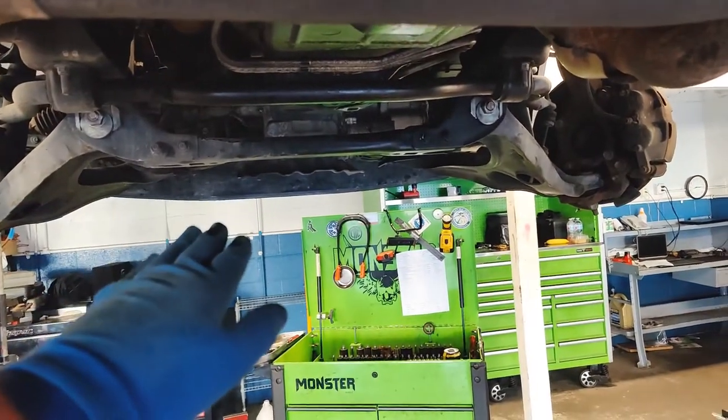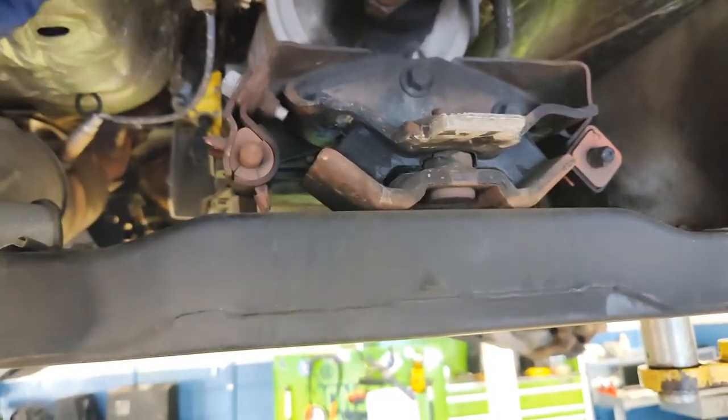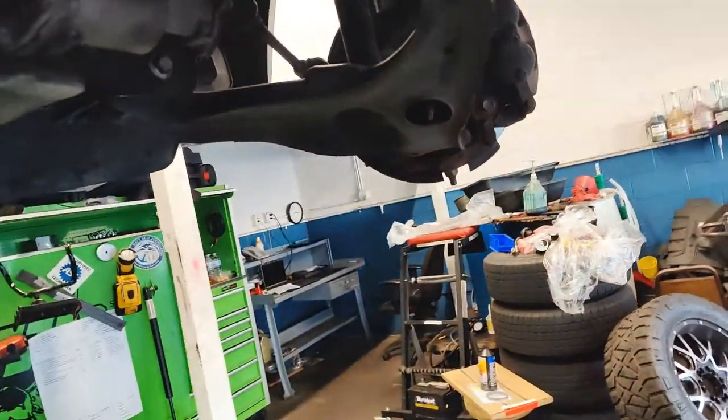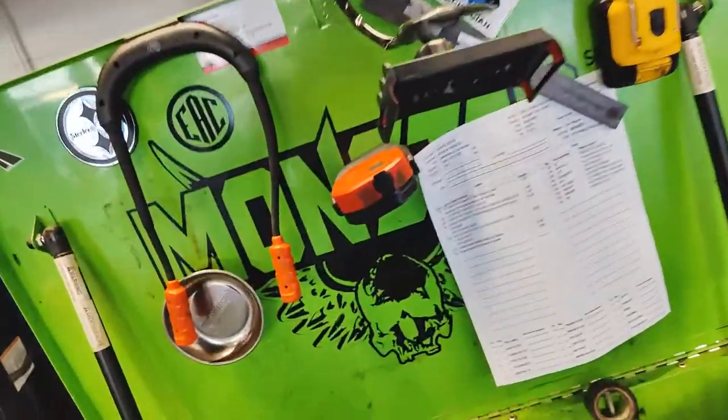And then we'll angle the tranny back a little bit down. The back of it is gonna come down a little bit so we can reach the top bell housing bolts, and then we'll work our way around. And then that will allow us to pull the tranny out, and then we can get to the rear main seal. While the tranny is out, we're gonna, let's not get ahead of ourselves. So let's start by doing what I said and getting the stuff around the tranny.